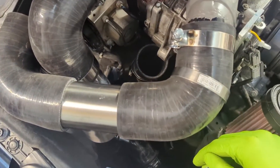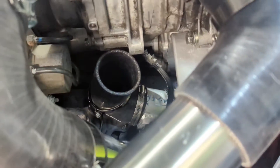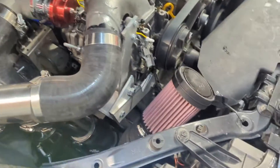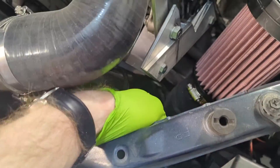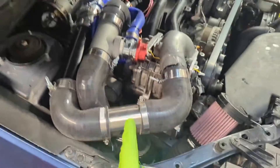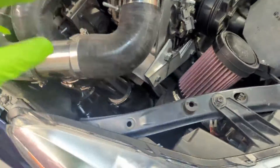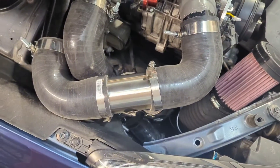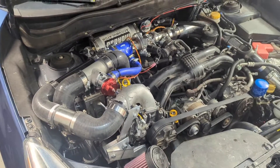To try to improve on the lean condition and refusal to idle, I'm hoping to straighten out the section of intake tubing near the MAF. Currently it's this S-shaped curve. Finished the new and improved intake pipe routing. We've got our air filter, do a 180 down there, go through the MAF sensor and then hit this T right here, giving a pretty clear supercharger path and NA path. My hope is that airflow basically speeds up going past the MAF sensor. Before it was a pretty tight S-bend with the MAF in the middle. Now the engine should see more air entering, inject a bit more fuel, and hopefully we can idle.